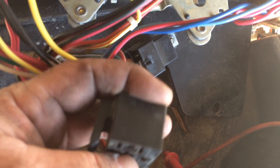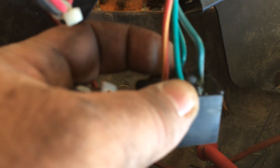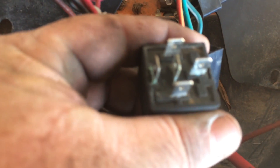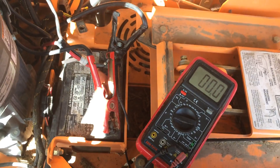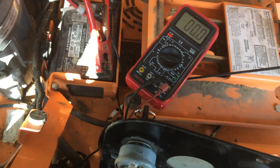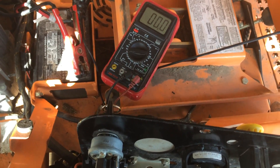On this Cheetah, we come over here to your starter relay. We've got voltage on these legs in the start position and it's not carrying through, so barring jumping 12 volts to this, this relay is bad. We will replace this starter relay and that will complete our circuit going to our starter. Any questions or comments, just leave them below and I'll answer them.